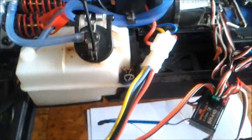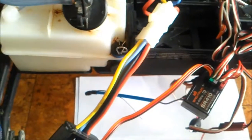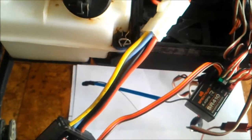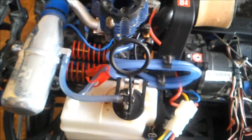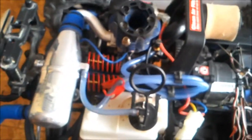What I've actually done is bought a new lead — the Lewis model Z10. I've had to cut the blue wire and rejoin it, so you can still use the original one on top of the glow plug because of the different size connector. I've removed the glow plug from the head and just put it temporarily so you can see the glow plug light up.